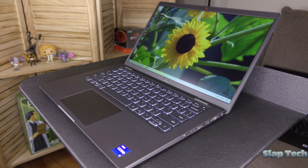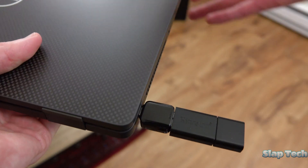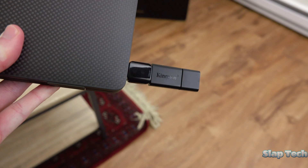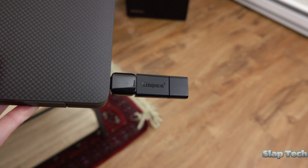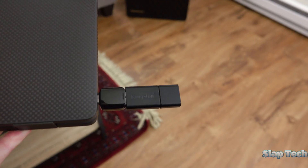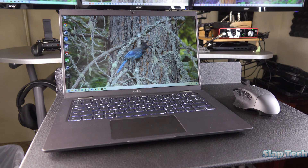Since the new SSD doesn't come with Windows installed automatically, we'll need a 16GB USB thumb drive to throw a copy of Windows on. The thumb drive must be at least 16GB in size, and the data will have to be wiped on it. So use something you don't have any other purpose for, at least for the time being — it can still be reformatted and reused later.